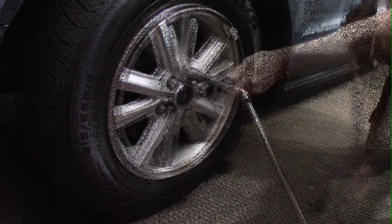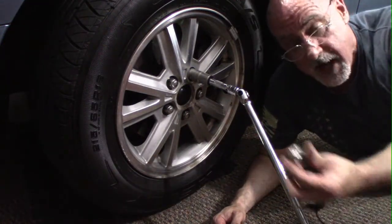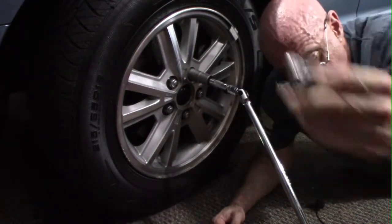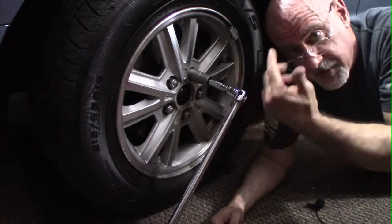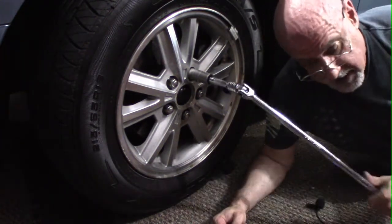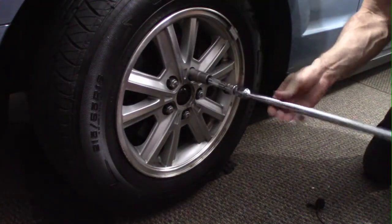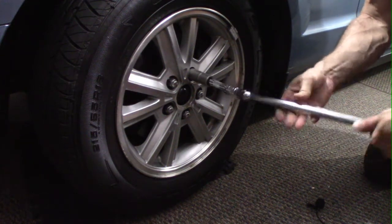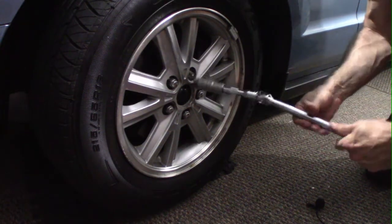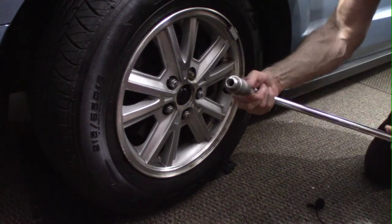As you can tell, I am sweating up a storm — it wasn't as easy as I thought. Number one, the chrome cap is what got stripped and just would not come undone. I had to hammer this thing on, and I actually stood on my breaker bar in order to get it out. But it did work! I finally got it coming out. Now it should come out easy. I'm not sure what kind of damage there is to the threads or the bolt itself, but this is how you remove a stripped lug nut.